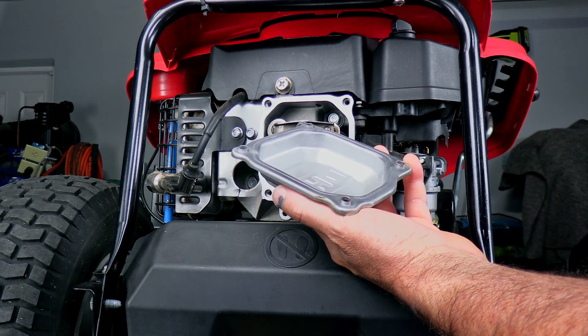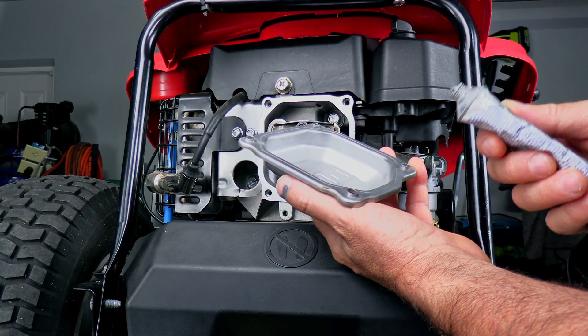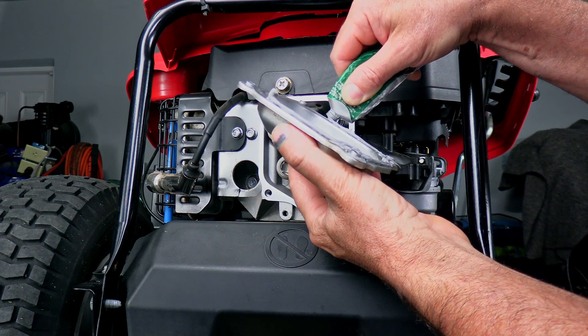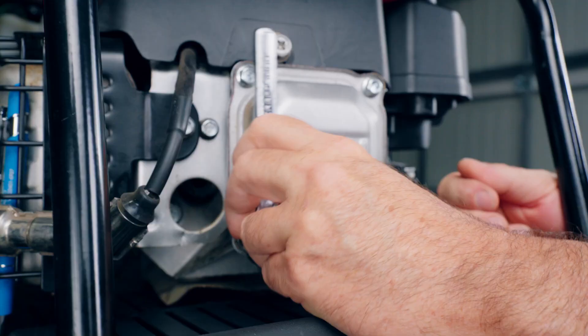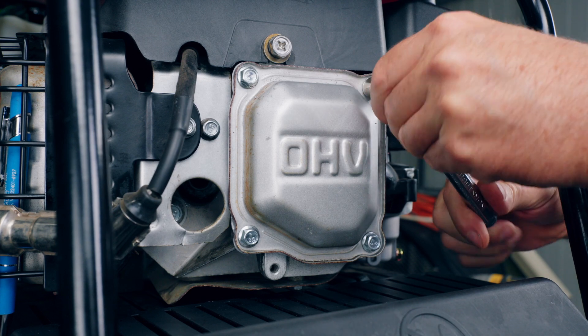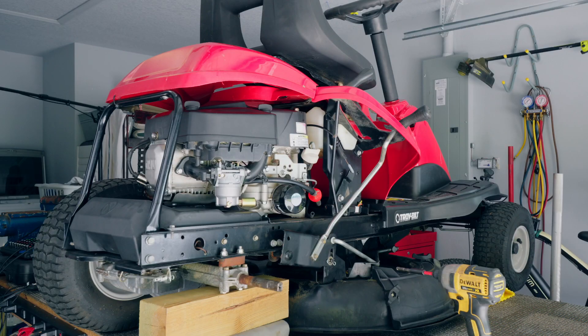Got the valve cover cleaned up. You can clean the valve cover with anything. I've got this gasket maker — I got it from Advanced Auto Parts — and just spread a thin layer around. Doesn't have to be thick at all, just a thin layer. Then just bolt it back on there. You can feel it when it gets tight enough the way this is made. I do want to mention that I let that valve cover dry for about an hour, maybe an hour and a half — I wanted to give that Permatex a little bit of time to dry before I put oil to it. Might not matter, but that was just my choice.